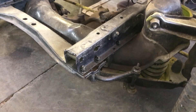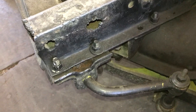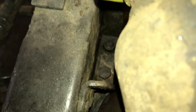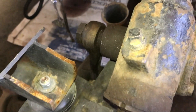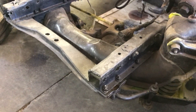To get this crossmember off it's really simple — thank you Chevy for being hotrodder friendly. All you do is remove these bolts: here's the sway arm bracket and the crossmember bolt right there, and then a couple down in here, same thing on the other side. Just a few bolts to undo, then undo the pitman arm for the steering — just undo the bolt and use a pitman arm puller. And that whole front end will roll right out of here.